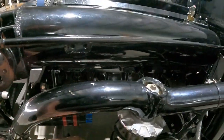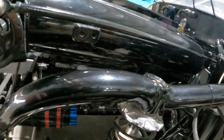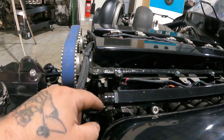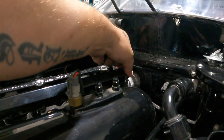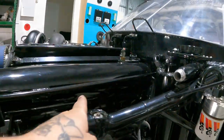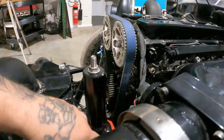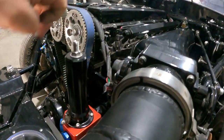All right, so what's gonna happen is one of them will come off and go to the pump, but the other one will go to this one here on the front and then shoots in here. It's then gonna be a 90 degree angle on here, and goes down to the bottom rail under here, guys. There's a bottom rail there, shoots onto that one, then flows in and pressurizes. All right, so then the whole thing's pressured. So this here will make sure that it has 60, 70 PSI at all times.